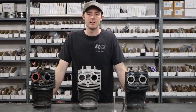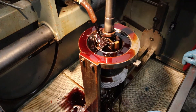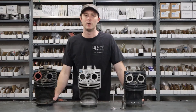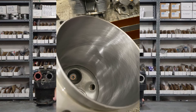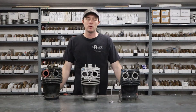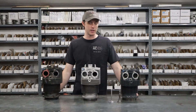Honing the bore — or boring oversize if necessary. We actually have a complete video about cylinder honing and I'll put a link so you can click over to that. The hone has stones on it that we run up and down the cylinder wall, enough to break the glaze off of the cylinder wall and give it a really nice crosshatch freshly machined surface, which allows the new piston rings to seat on the cylinder wall. And then once the cylinder is honed or bored oversize, the last thing to do is paint it. We'll put a nice fresh coat of paint over the cylinders and we're ready to assemble.